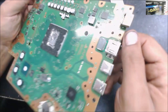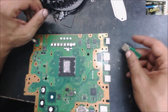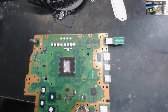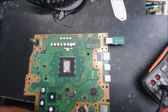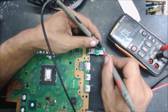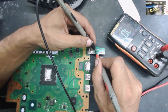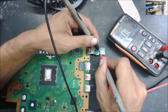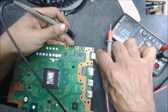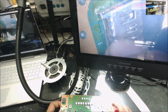So I did the job — I replaced the HDMI port. I checked the pads and checked for solder bridges. Everything looks okay. So we check for bridges on this one. No bridges. That's the new HDMI port. You can see the pads are solid.